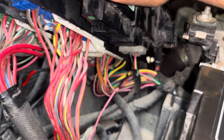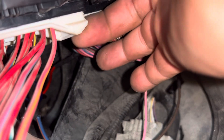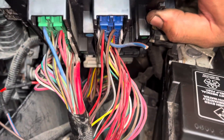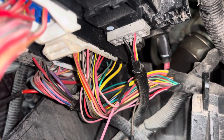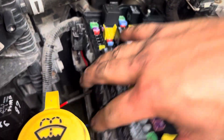That's pretty much it. When reassembling, just take your time moving these connectors. There's a release tab and the whole thing swings down. The connectors are color-coordinated — blue, green, gray, and black — but for this bypass we're only concerned with the blue connector and the black connector. You can undo the others if it makes it easier to move the TIPM fuse box out of the way.